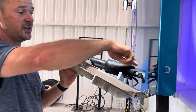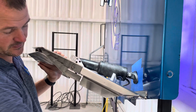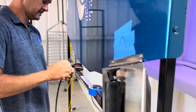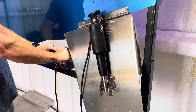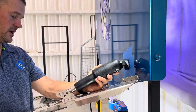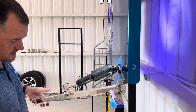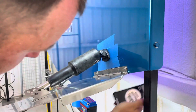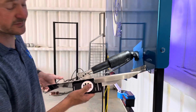Now that I've found an acceptable number — 21 degrees — I'm going to trace this line right here where the upper mounting bracket is, just put a line over the top so I know where that is. Now I want to check the deployed position. I'm going to fully extend the tab. I've got the mark up here, holding it right at that mark with a little bit of up pressure. Calibrating on the imaginary bottom of the boat — and I'm only deployed eight degrees. That's probably not enough.